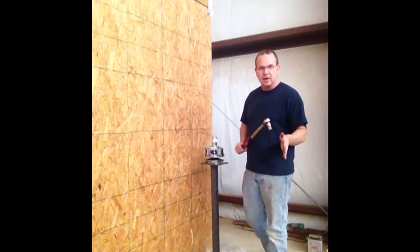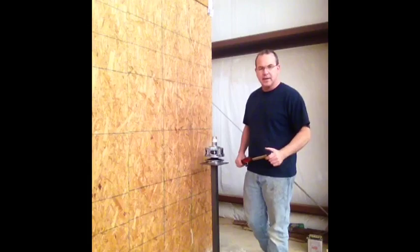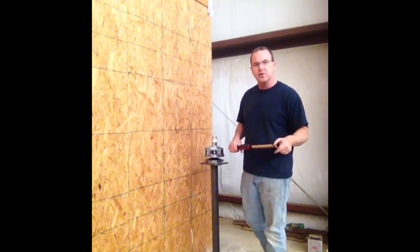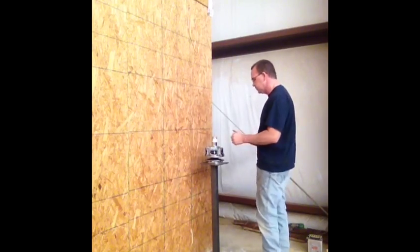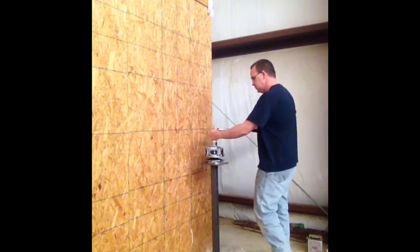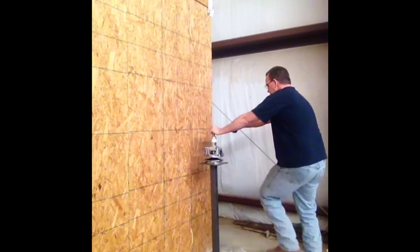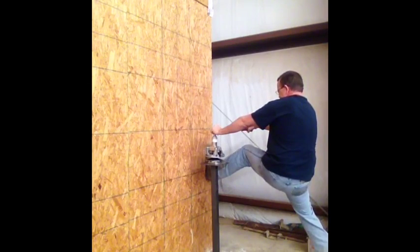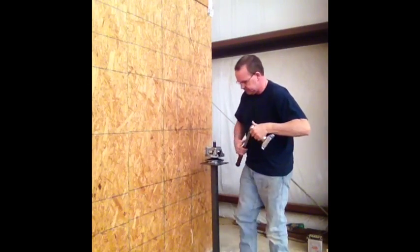I'm not saying I condone this, but there's a lot of people who put a cheater pipe on it and tighten it up. Since I'm telling you in the video, you better go by the service manual's torque spec. 200 for 800s, 280 to 300 for 900s. Alright, we're torqued.